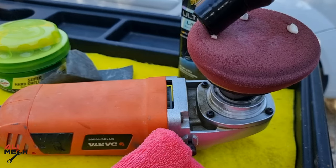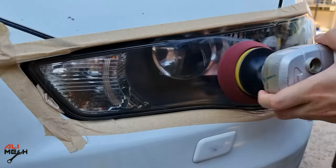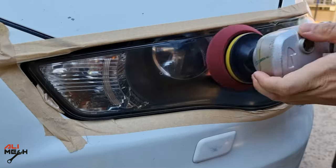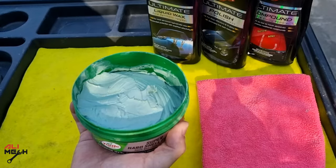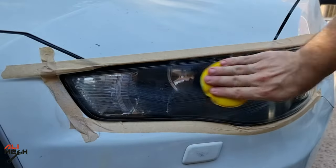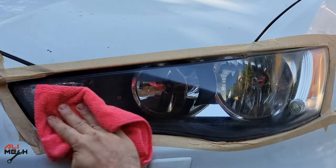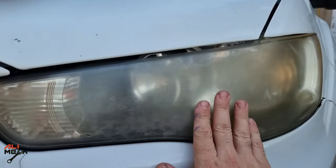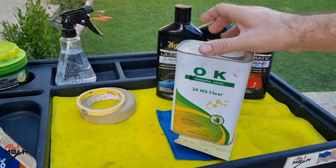Next I'm gonna apply a polishing compound — it will refine the surface even more. This is the last step: we apply wax to protect it from getting oxidized again. So let's go ahead and apply a thick coat of wax and let it dry. After 5 minutes the wax is completely dry — let's wipe the residue with a microfiber towel and reveal crystal clear headlights. The difference is like night and day. Here is how it was before and how it is now, using some sandpaper, clear coat, and polishing compound.